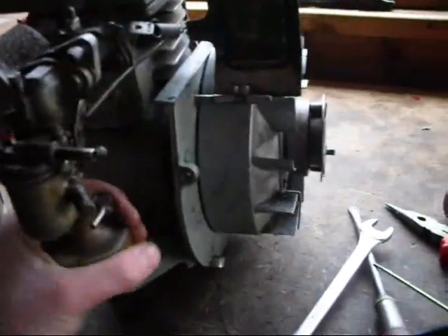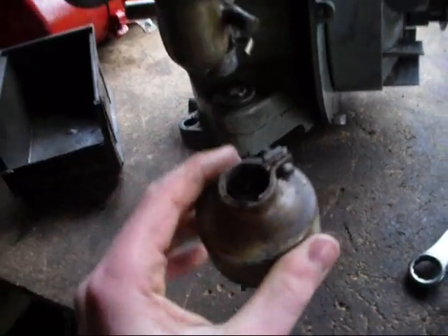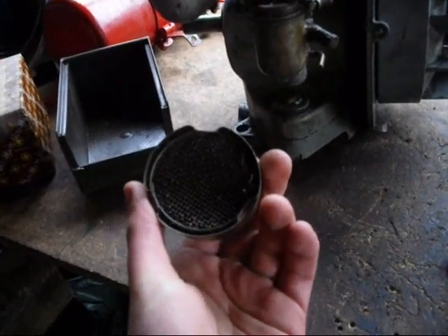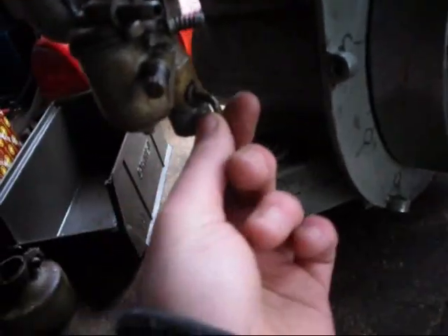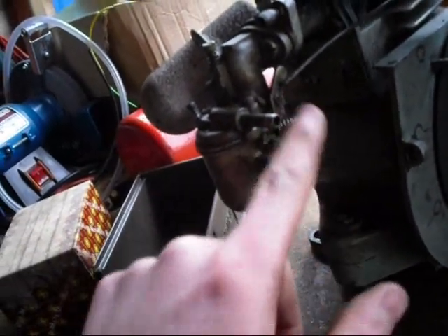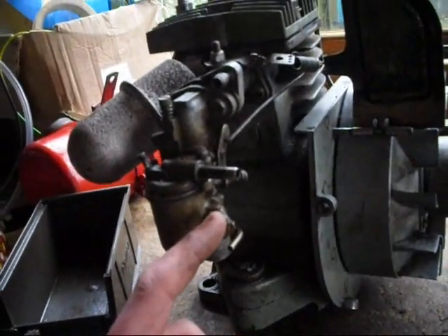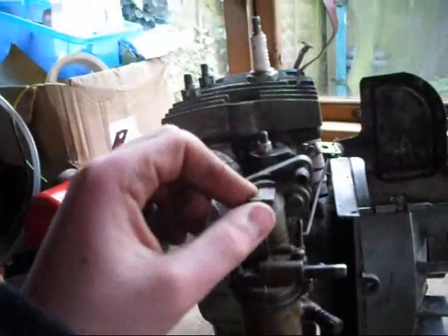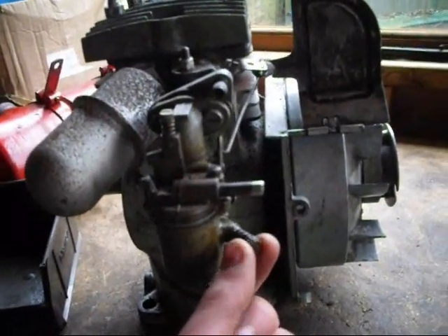So now I'm just going to clean everything. This filter will come off - it's absolutely filthy inside and all it has in it is a sort of steel scrubbing thing like you'd use on steel pans. That's the choke there, that's the throttle, which works a little butterfly in there. And that's the governor - a very simple air vane. That's the high speed jet, which you use only for high speed running. This controls the air flow and mixture, which you use to get a good idle. I actually need to adjust this as it hunts very badly at high speed.